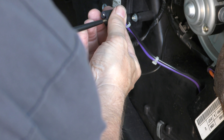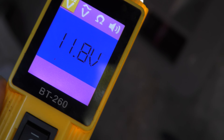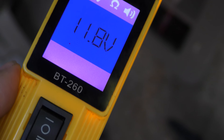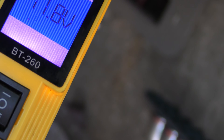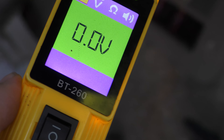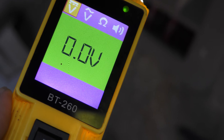Okay, it's got 11.9 volts. Now 11.8, 11.9 volts is a little low, but it's enough to make it run. And as you can see on the other side, when I check the other part of the wire, it shows zero and it's green — on this thing, that means it's got good ground. It's green when it has good ground.